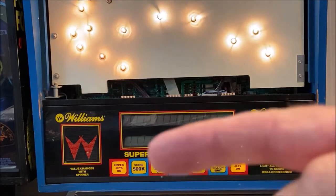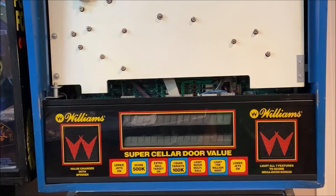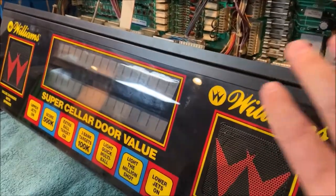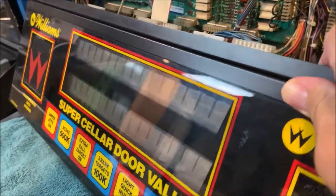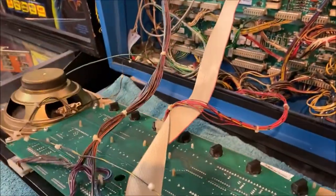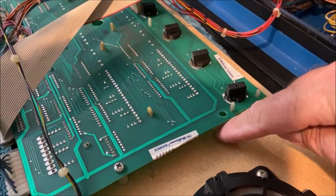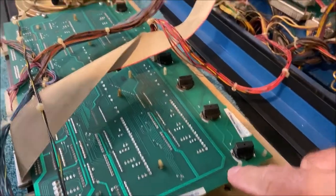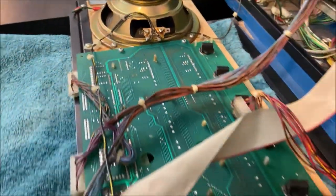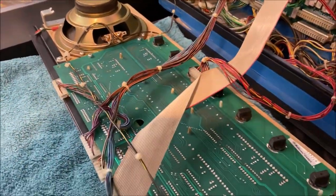The first thing we're going to do is remove the display. I'm going to turn the game off, unplug the game, and then remove this piece. Now I'm removing the score display — I lifted it up off the brackets that hold it, laid a cloth down so I won't scratch anything, and laid it forward. There are four screws — mine only has three because one is missing — and then I'll remove five connectors. Once those are disconnected, the whole PCB with the score displays can be lifted off.